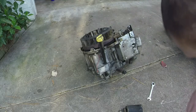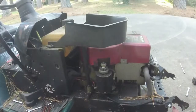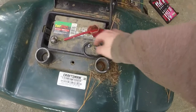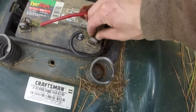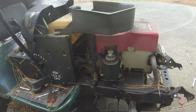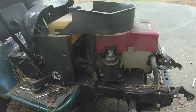Let's move over to the one we're going to fix. First off, number one: disconnect your battery. All you gotta do is come back here with a 7/16ths — you can see some of the terminals are a little corroded on this one. Just take the negative terminal off. Then we'll get the positive terminal off, and then we'll get the two mounting bolts off. I'll show you that they're the same starter.